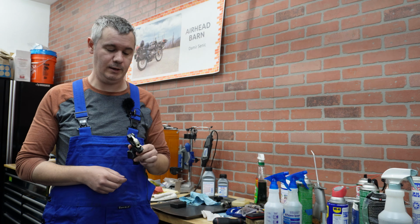So the fourth option is basically to take really fine sandpaper on a Dremel and try to get rid of these nasty parts on the cylinder wall. The piston that pumps the fluid has seals made of rubber, and those are much larger than the diameter of this cylinder, which means that even if you ruin the roundness of this thing, it becomes elliptical, or your bore is a bit larger than originally was, that's still fine, because that rubber tends to compensate for that, because it's much larger, and it should work.